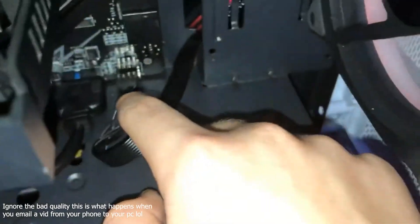I just sort of got excited when it turned on and I haven't put the side panel back on because I got excited when we finally got it working. We were trying to figure out what was wrong - I unplugged the front panel connectors because I wasn't sure what I was doing with them, moved the connector one pin too far across, plugged it back in, turned it on, and it's all on fine now.